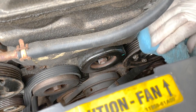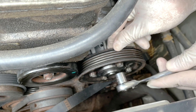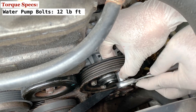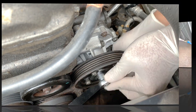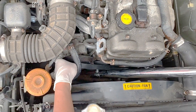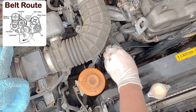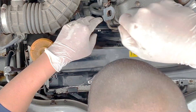If you got messy like I did, just wipe it off so it doesn't get sticky on the pulley. Using a 10 millimeter socket and socket wrench, just tighten it up — the thread locker will help it grip in place so you don't have to over-tighten it. Now with a 14 millimeter socket, socket wrench, and makeshift breaker bar, press down on the tensioner so you can put the belt back. Make sure the belt is in its correct position.